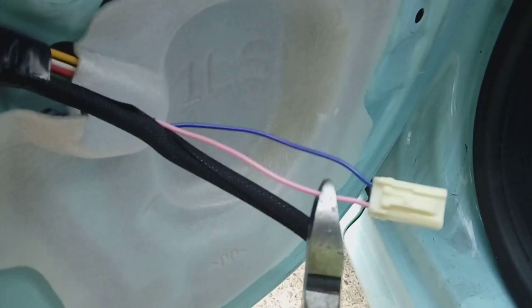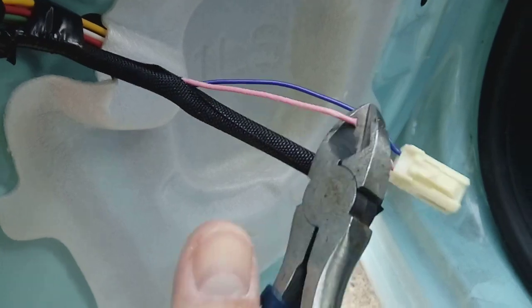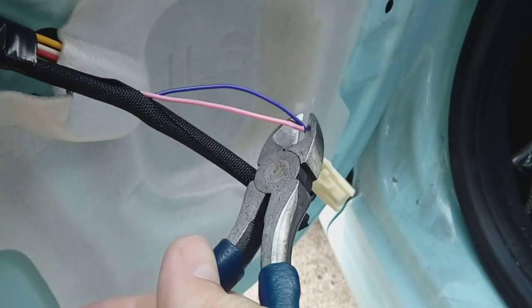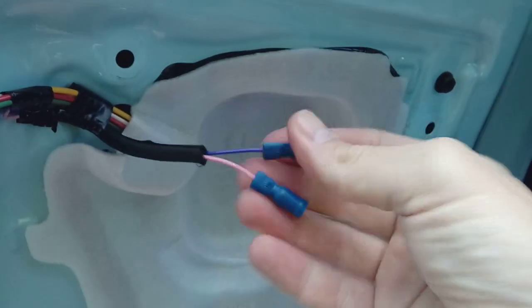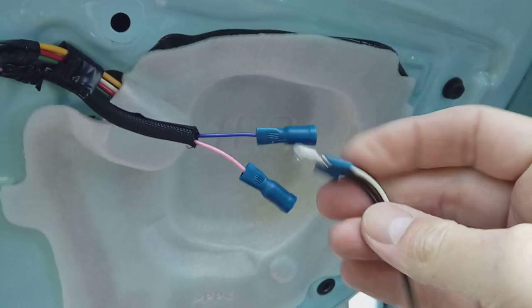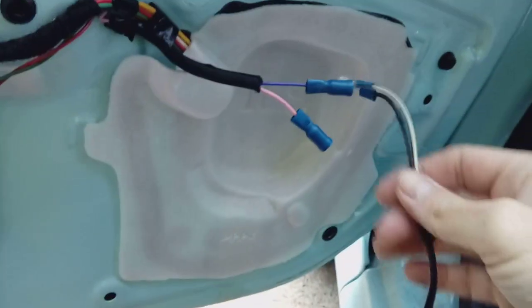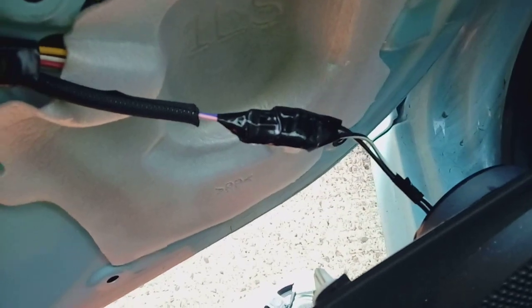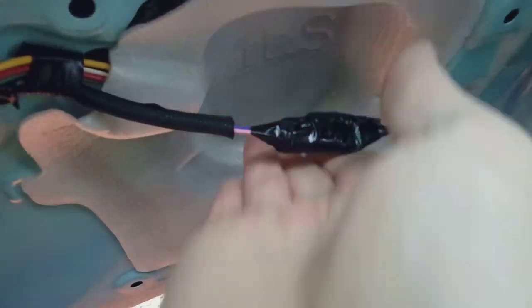Or if you've got a proper adapter cable that came with the kit, plug it in now. We've crimped two bullet connectors on the end of the wiring — you can solder it but crimping is fine. There's your door card ready, lined up with the wire. Simply plug in — remember pink is the positive, so follow it through. We've connected the bullets together and electrical-taped them all up so they're nice and sealed.